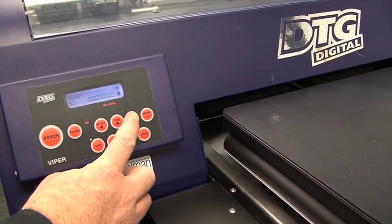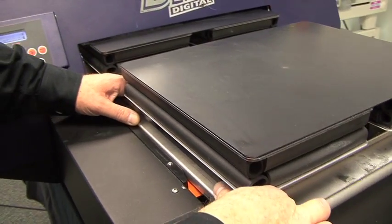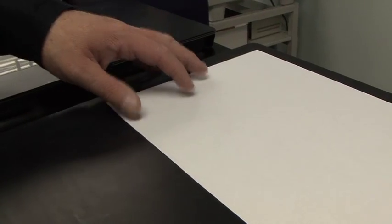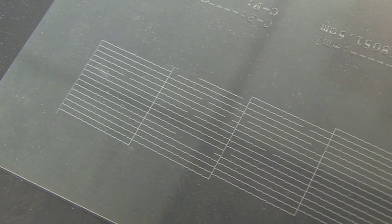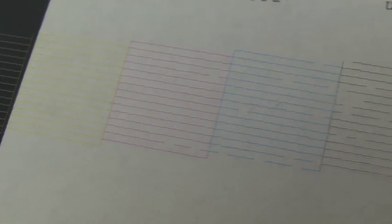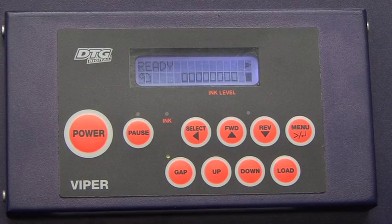Now it's safe to reverse the platen. I press reverse and it will pull out the platen partway — that's as far as it will come back. So now we simply grab the platen and pull it out of the machine. I'm going to take a white piece of paper as well as a black background and take a look at the nozzle check. If I put this in front of something black, it's very easy to see the white — notice the breaks in the white. If I put this in front of the white background, that makes it easy to see the color sections. Again, we have some breaks in this. The breaks mean that the printhead is not fully primed or that we have clogs. On a new machine, it almost always means we just haven't primed it enough. The way we're going to prime it is we're going to do a couple head cleanings, and that will prime the machine the rest of the way.